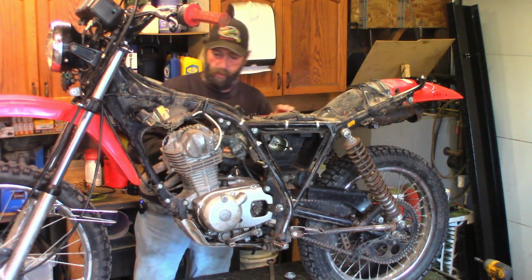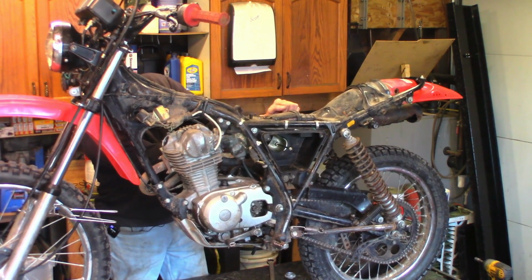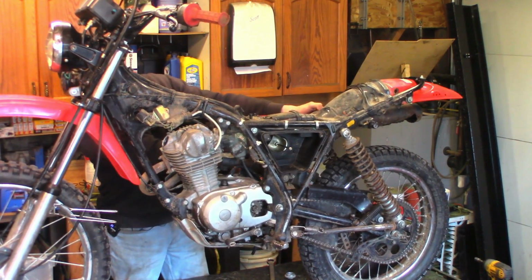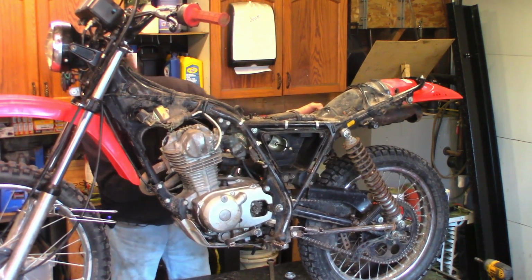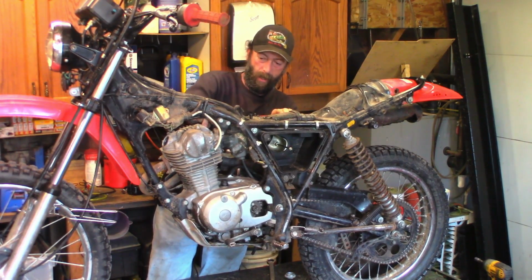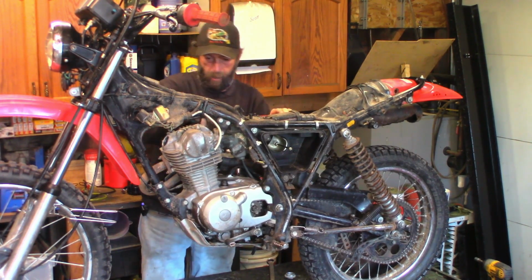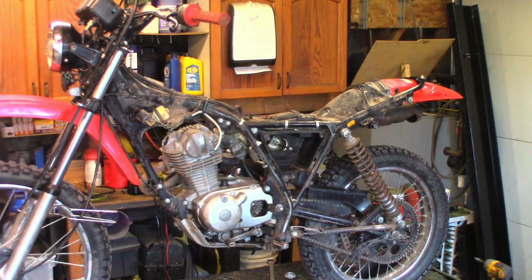there's no play in the intake valve. None. That'll give it a weird uneven idle. I'm doing it with a kickstarter, which is very crude. I'm not feeling any play on the intake valve. None at all. Excessive in the front and none in the back. Well, that might change the way this thing runs.